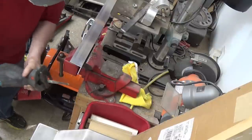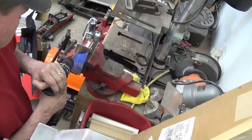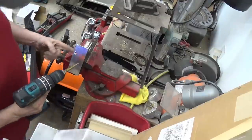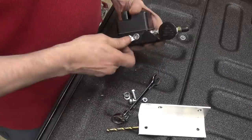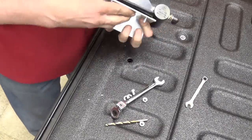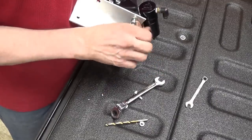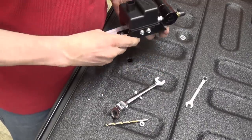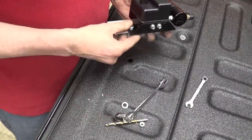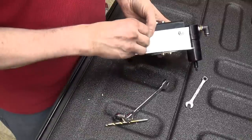With the compressor mounted, I chose to make my own bracket for the air manifold. I just cut off a piece of aluminum angle and drilled holes into it to mount the manifold, then simply by using the Airlift's bracket, I attached my bracket to it — all the while anticipating the required vertical alignment of the air filter. That air filter is that black cylinder with a pointy thing on the end. It has to be perfectly vertical for it to extract water from the air properly, so it's just a question of anticipating that orientation when mounting to the steel plate above the spare tire.